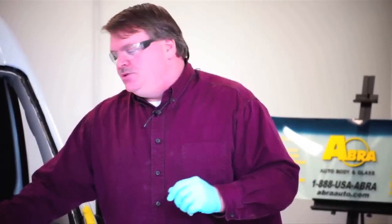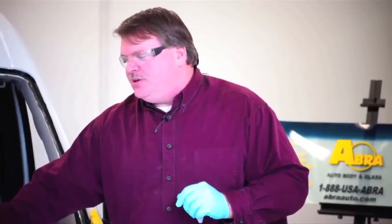He's going to paddle across those seam points. Once he applies this urethane, we have roughly about 6 to 10 minutes — at temperatures like today, about 6 minutes — to set the windshield in place. So now we're going to get the urethane onto the vehicle and get the glass set in place.